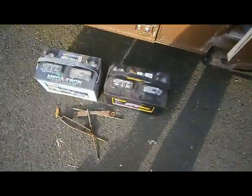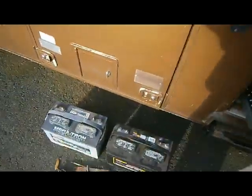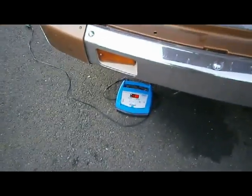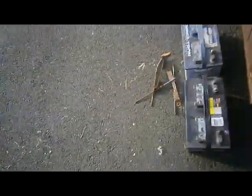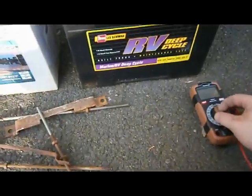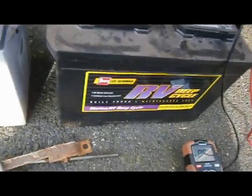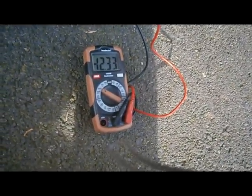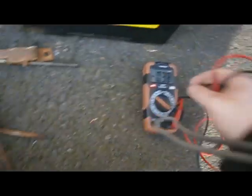I decided to get into the batteries here. The house batteries are mismatched — one does not work, this one does not hold the charge, and this one sort of does. I'm considering putting that one up front since it has a separate ignition battery, but that also does not seem to be doing very well charging. I've been keeping an eye on it — it had been charging all day since it was hooked up to the RV, and it's slowly dropping. It was 12.4 volts about 10 minutes ago.